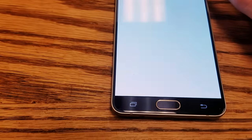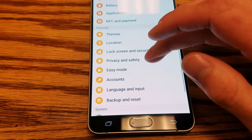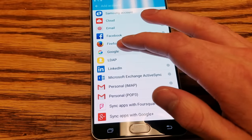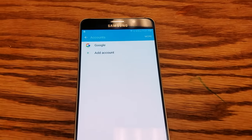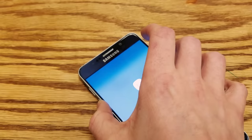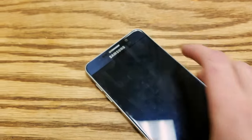I'm going to add a Google account to the phone I have here. Alright, Google account is now on there and we're going to do a hard factory reset. If you hold down the power and the volume down, you get a little boot menu, and we're going to scroll down and do a factory reset.